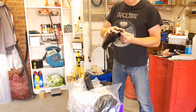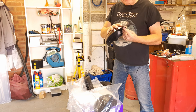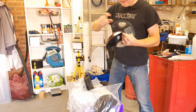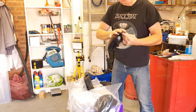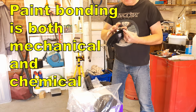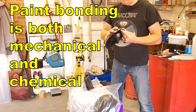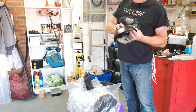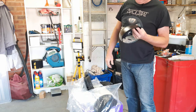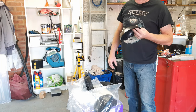Different plastics require different techniques to prepare them for paint. Some plastics are very difficult to paint robustly, because for some plastics the chemical bond between the paint and the plastic is extremely low, so special techniques are needed. Hard plastics such as this mirror cover are easier to paint than soft plastics such as those body strips.